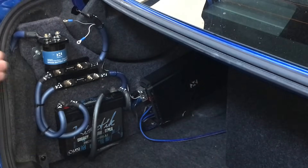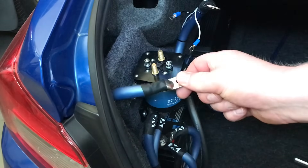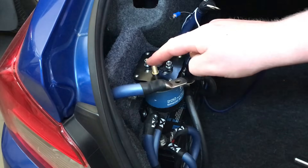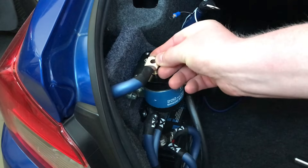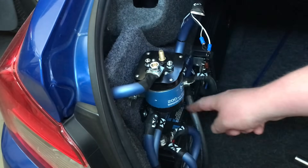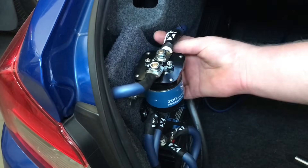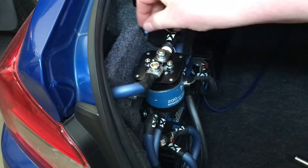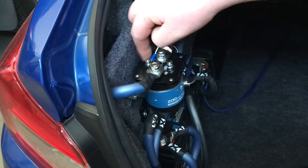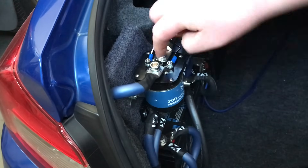We've chosen our location, got our isolator mounted — let's go ahead and do some wiring. Being that this is our charge wire, make sure your primary battery is disconnected so you don't have a live wire as you're hooking this up. It doesn't matter which post you hook it to first, but we're going to put it on this post. This end goes down to a fuse and our secondary battery bank, and we'll put it on the other side. For these smaller wires — remember, one's a trigger wire and the other one's a ground — we grab our positive and put it toward the back terminal, same thing with our ground wire. Let's tighten everything up.